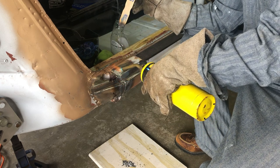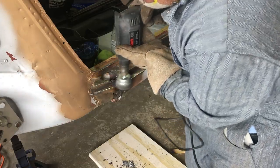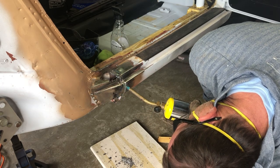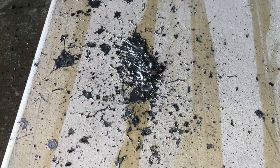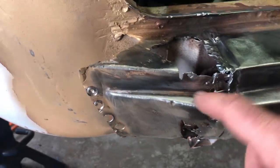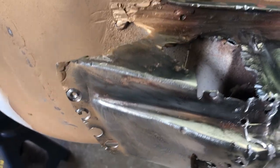This whole car is assembled with lead filler. They don't use Bondo in 1969 - I don't think it existed - but lead filler is the thing. While we were away, I took a propane torch and melted off the lead filler. This is what it looks like - this craziness. I just put a board underneath and did it really easily with just a regular propane torch. I used a little spudger, which was basically a paint stirring stick, heated it up and moved it off, and it worked great.